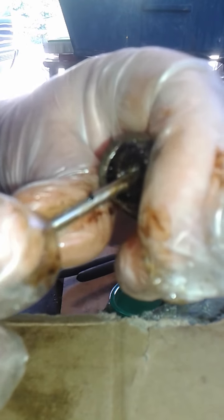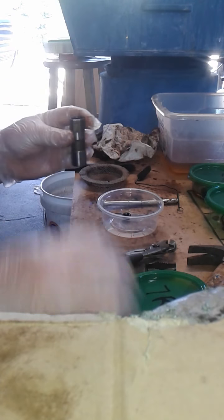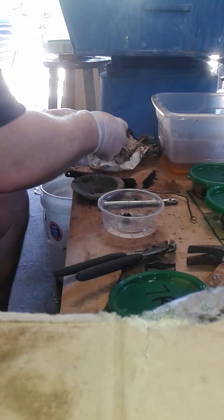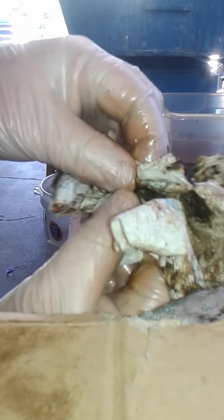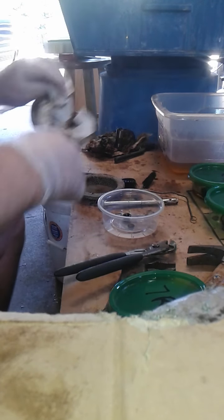Inside of that you're going to get this hat — it's going to come out. Be careful, there's a washer in there too. Lately I've been having to bang it out, so you're going to have to bang this on a tissue or something so you don't lose it. There it is — put that aside, let that drain for a minute. See this little flat washer thing — once I get all the gunk off it, that just sits in there and actually kind of regulates the flow when the lifter is going up and down to let the oil in and out. Throw that in the bucket.